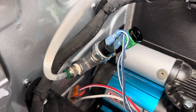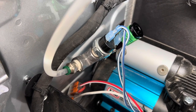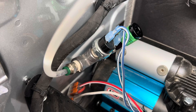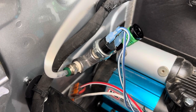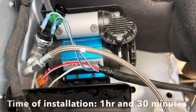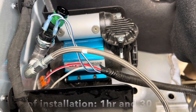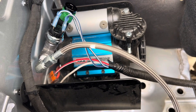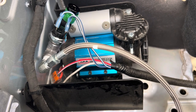Running the line up to the front did prove to be a bit more of a challenge, particularly getting past the gas tank and the gray water tank. But now I'm up front and going to disconnect the existing hose that's been so problematic and connect the stainless steel braided line. Installation is complete. One word of caution as you're coming up through the engine compartment: be careful going past the alternator with braided steel lines — you don't want to short things out.